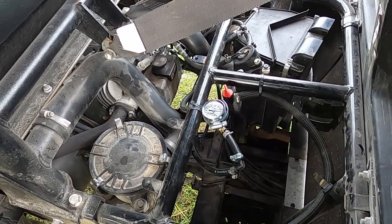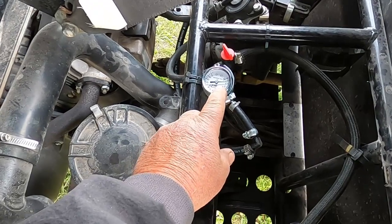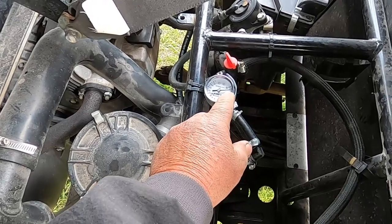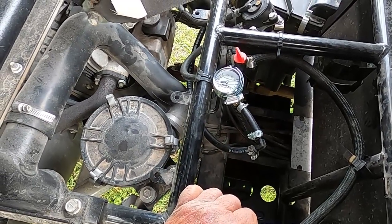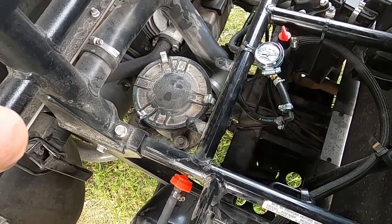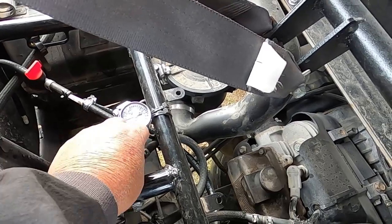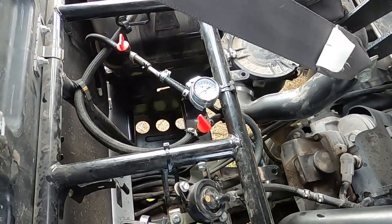What's interesting now is I cut the fuel off here — that cuts it off from the tank — but we're maintaining pressure, and I don't like that because the needle valve has to hold that pressure back and I can see it dropping, so it's got to go somewhere. Maybe I should have left that cutoff valve on here. We went about a mile, I've got one and a half PSI. We're going to cut the fuel off to the carburetor and now relieve the pressure. I think that's going to work.